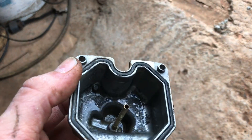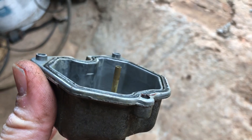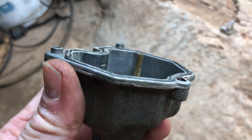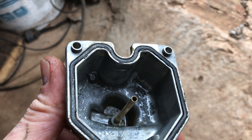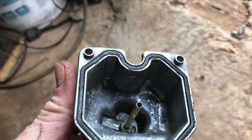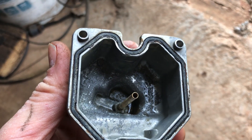If you get the light just right, you can see compared to the upper part of the float bowl off the carburetor — it's pretty much the same texture — but if you look in the bottom of the bowl, you see all that corrosion that's been taking place. That comes from ethanol gas. Ethanol attracts water, and when that water sits in there against that metal, it starts corroding it.